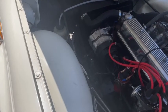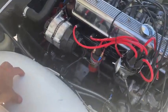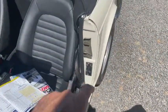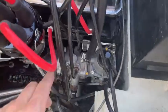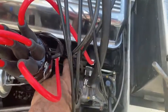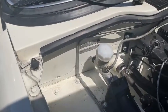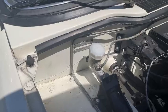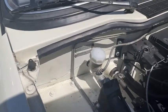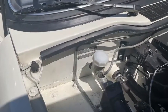If you're not sure which model you have, you can look at the chassis plates. For earlier models you'll find a plate on the inside front wheel arch; for later models, as on this one, there's a plate inside the door closer. Engine numbers are stamped on a tab on the side of the block. There are also two internal Triumph plates on the bulkhead used for body-in-white and manufacture records — you don't actually need these numbers for ordering parts or restoration.